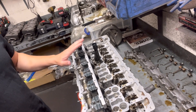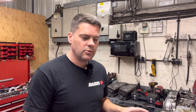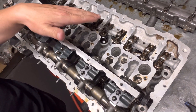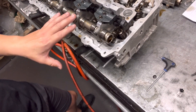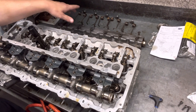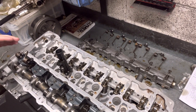Okay guys, so we've got all the bits now for the BMW six-cylinder head. This is the one down here with the contraption of weird springs and stuff like that. We've got the valve stem seals, we've assembled the head, we put all the springs in, the rockers are lying on the top. The camshaft is in here. Now what we're going to do is I'm going to show you how to apply the new special tool to these springs and the order in which you assemble it.